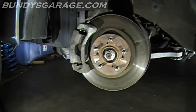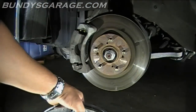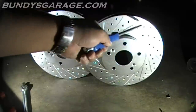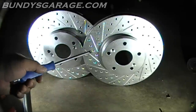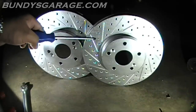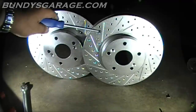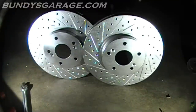One thing I'm going to do different when I replace these rotors — I'm going to use cross-drilled and slotted rotors, like that one right there. These are the rotors I'm going to use on the van. As you can see they are directional — this one is for the driver's side since the grooves are cut this way, and this one will be for the passenger's side. The cool thing about slotted and cross-drilled rotors is that when you brake and the brake pad heats up, the brake pad actually releases gases. These gases get trapped on a standard rotor, but with these holes and slots the gases are able to escape better and quicker, which allows you to brake faster — so in the end it's basically safer. Quicker braking leads to more safety.